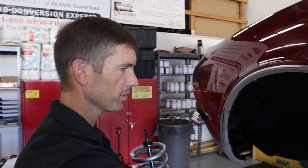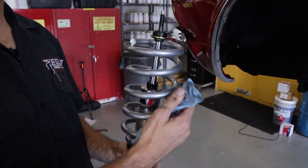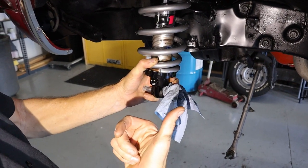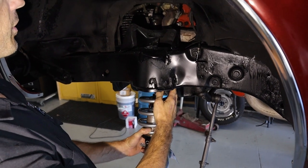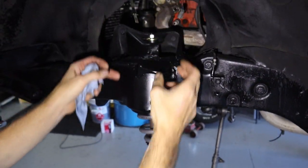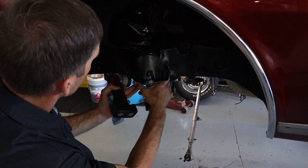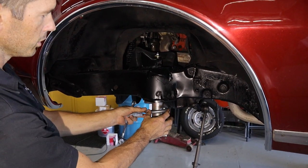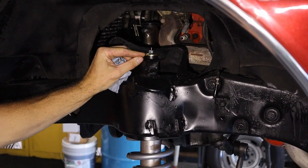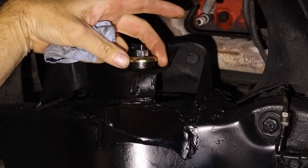The proud Camaro owner cleaned up both sides and did a little detailing — cleaned all the grease off. First thing going back together, I like to start with the coilovers. This one is adjusted all the way to the bottom. It's going to sit in the upper pocket with the adjuster facing outward toward the spindle. Get it in there, then put the rubber, washer, and nut on. Look from the bottom to make sure it's all centered in the cup and the spring is in the right spot. The adjuster should face to the outside. Tighten up the shock — just squish the rubber down so it expands even with the washer thickness.